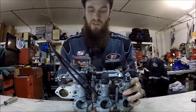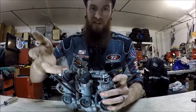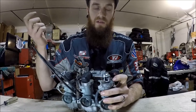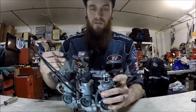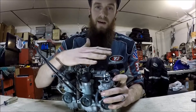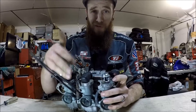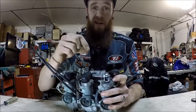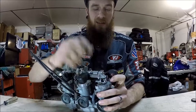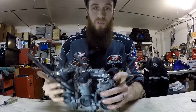The tricky part with these is that when you go to lock them down, they tend to twist a little bit and change. After you've made your adjustments, turn the bike off and give the throttle a couple slaps so it can seat itself back down and readjust. You'll be doing that over and over on these until you find a way that they're all lined up, because every time you tighten this nut down, something always changes. So it'll take a little bit more work for this style.